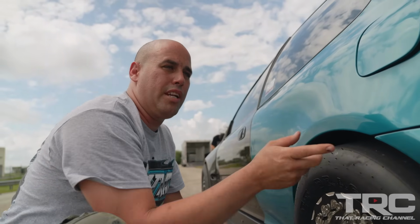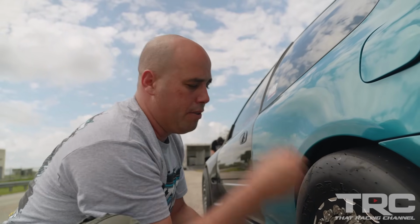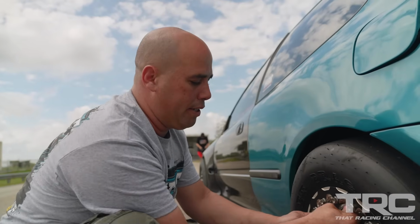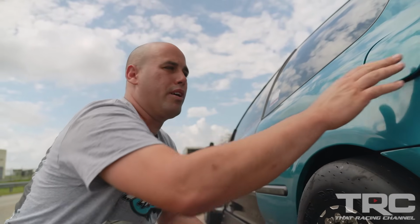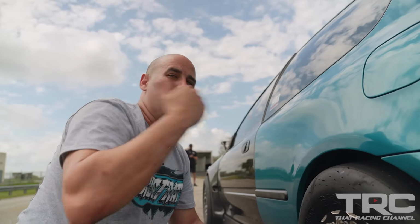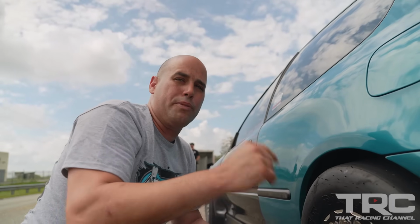So you can't spin this car if it's limited. It messes with the setting for the strain gauge. Sometimes it's better if you take off easy and the RPM drops, then it goes up a little bit. If you take off too hard, the RPM bounces on the limiter and it won't go on second. That was the main problem with this car on the streets.